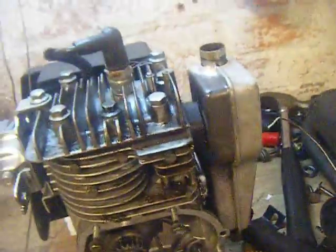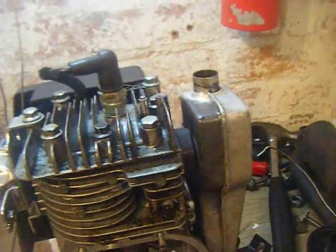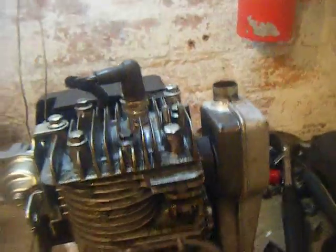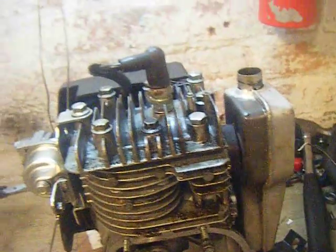except for your exhaust. If your exhaust's on in the normal position, like that, you can get water in there, and if you're going to leave it outside in the winter time and you're not really going to use it that much, it's going to be left in that position for a few fair months. If you get water down there, that's going to fill up quickly, and you're going to get water in your engine and it'll seize it to shit. So flip your exhaust over. Like that.